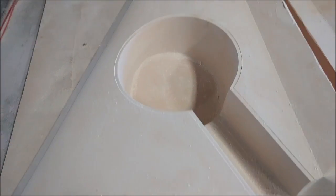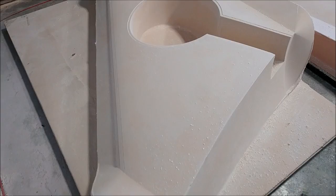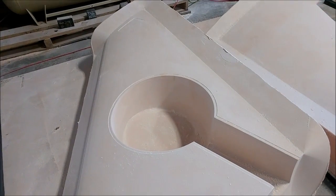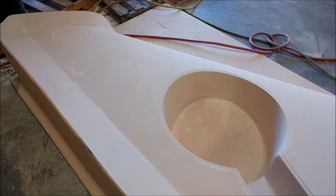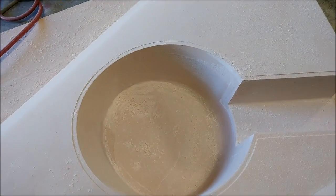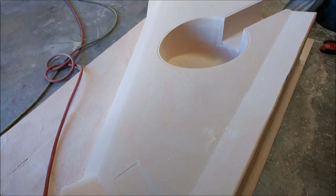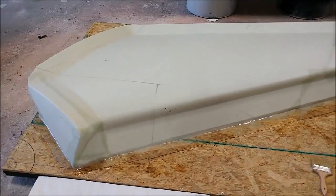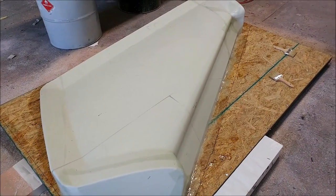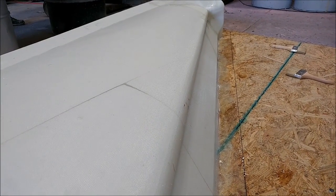A closer look at the left side one with the shavings blown off — you can see how nicely it came out, with a little joggle on the leading edge where the top surface overlaps the bottom. The right side one came out equally well, not much work required to get it ready for the first round of primer. The guys have completed glassing the left side upper wing strake, so it's ready for putty spray now. This is good practice for when we do the rest of the wings using the same techniques.